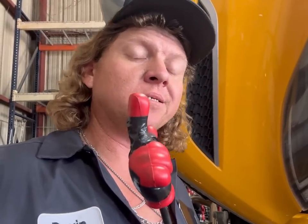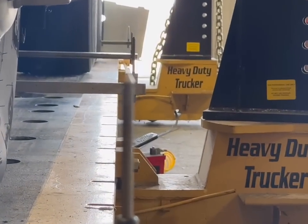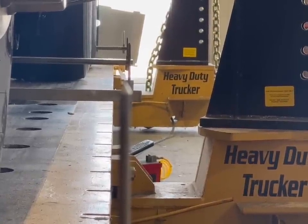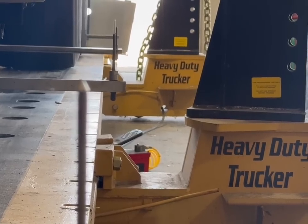One of the things we're going to talk about is gauge placement and how to read these gauges. These are Beeline manual gauges — they take a little bit of sight, but they all line up with each other. Point of reference from gauge to gauge is what gives you the in and out of the frame. If you line the front gauge up with the back gauge, you can see how those two middle gauges are not in line with the front and rear gauge. Moving out here, the next gauge back is not in line with those two gauges, so you know that is the furthest point out.